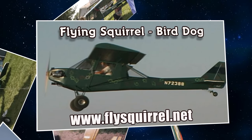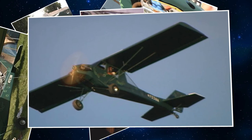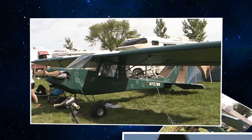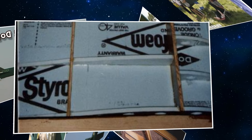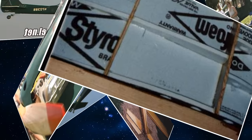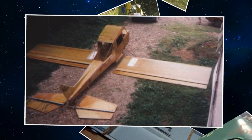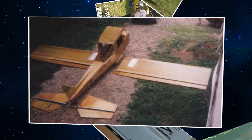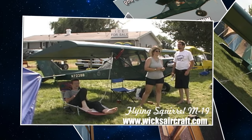Most of this airplane, from what I've been listening to, is made out of wood? It's actually a wood structure and a styrofoam inlay with fiberglass covering. Is that the same construction as the original Bird Dog? No, they were aluminum — this is composite. Why have you gone to wood rather than 4130 chromoly steel? Chromoly steel may have advantages, but your average home builder usually hasn't got the skills for metal airplanes, and composite construction is something the average person can master pretty quickly.